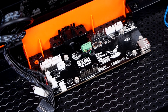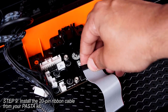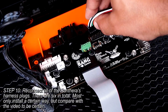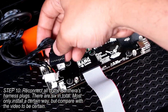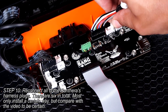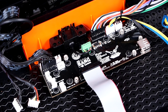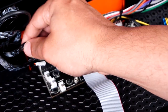Let's get started on the plug-and-play wiring. This part is pretty easy, so just follow along. Take the 20-pin ribbon cable included in your kit and connect it to the 20-pin connector on the front of the Pasta Board. Make sure the ribbon is facing in your direction and not away from you. Next, reconnect all of the Panthera's wiring connectors. While most of the connectors are keyed to specifically go into a certain plug, please follow along carefully to avoid making any improper connections. There are six connectors that need to be plugged in total, so do a headcount. Double check to make sure every connector is properly seated.